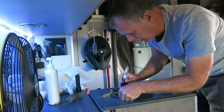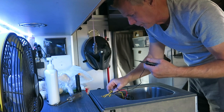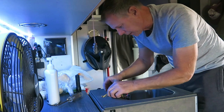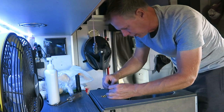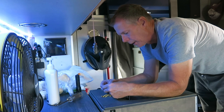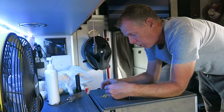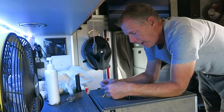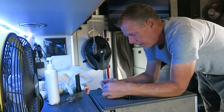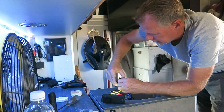And then we don't. So it's this connection right here, the one that I was just talking about, where I was having trouble with the spade connection. So obviously my fix-it job didn't work, because what I really need to do is replace the entire wire run, because I don't know how far back that corrosion has affected this wire. I had never seen wire that got that brittle where I couldn't strip the insulation off without snapping the wire.